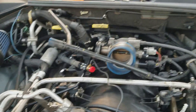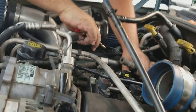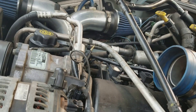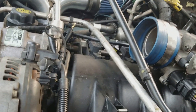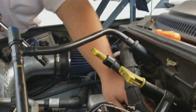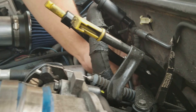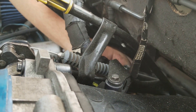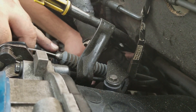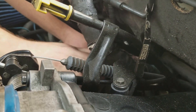Go and plug everything on that side, plug all the cylinders again. Pull the coil off. We're gonna get — it's kind of tricky. You have to take the extension with the socket, put it in there somehow, drop it in there, feel it around, push it on the plug, and then put it on the ratchet.